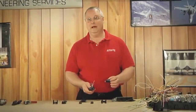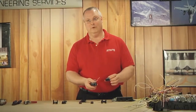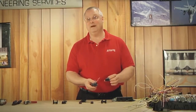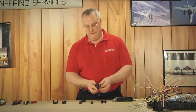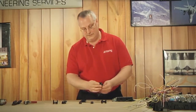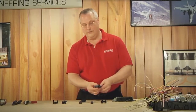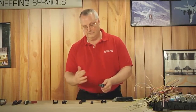To save you folks a little bit of time, I went ahead and replaced this connector, swapping each wire one at a time to make sure I maintain the proper pin position. Let's put this back together again and get this vehicle on the road — it's going to be a reverse process. We have all the terminals in place, do a tug test — always a good idea on every terminal that you touched — and now let's reverse the procedure.